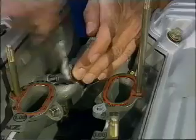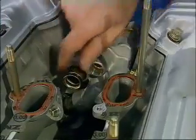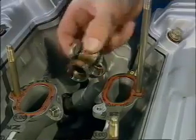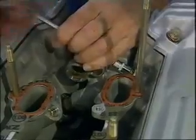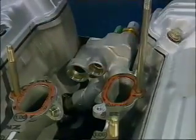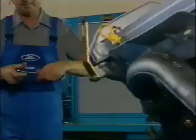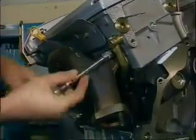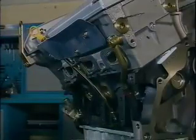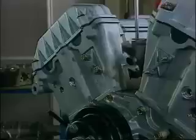You'll find that the thermostat housing is a new design. An unusual feature is the connection to the left-hand cylinder head, which is by means of a small spacer tube fitted with O-rings. The connection to the right-hand head is more conventional. You'll find nothing new in removing other ancillaries from the engine — items such as the exhaust manifolds, the heat shields, the oil dipstick and tube, and both oil return pipes running between the heads and the oil pan.